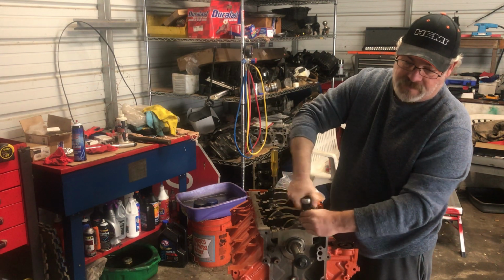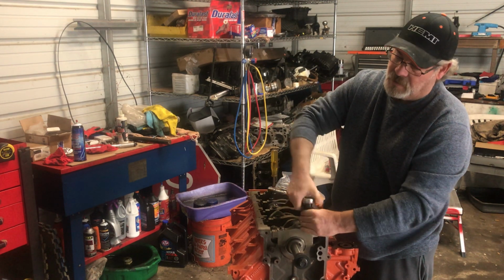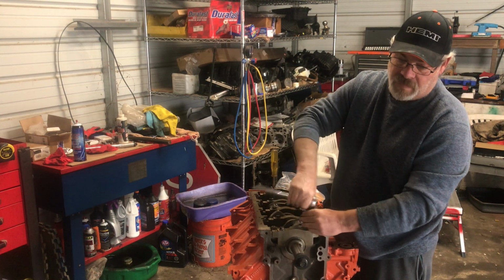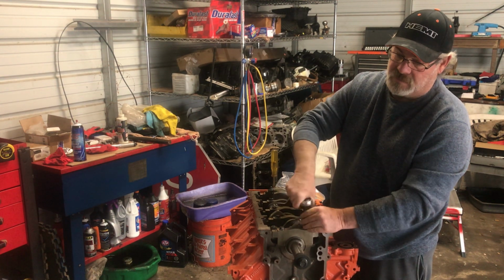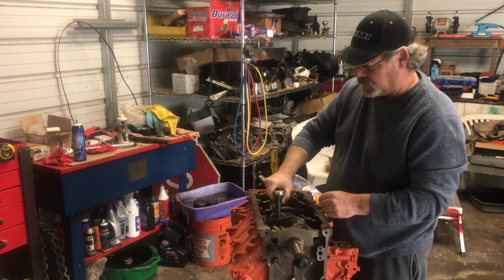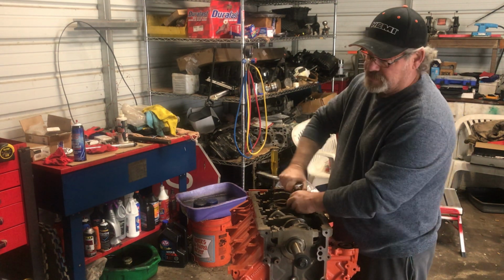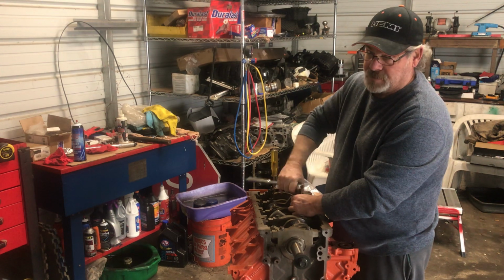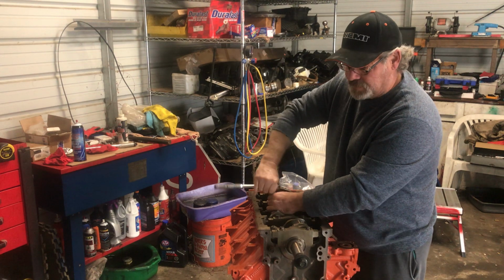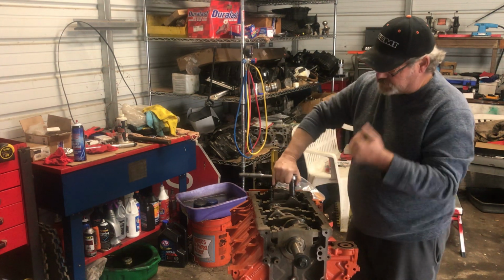And if you're putting a cam and stuff in it, you want to check your pushrod length, because a lot of people do an 070 gasket on it. That gets you down to 11.5 to 1. You can use the Eagle pushrods, but you're going to be at almost zero lash with them. But it's just better to get the right pushrods. But you guys out there that are budget savvy, you can do an Eagle head swap.